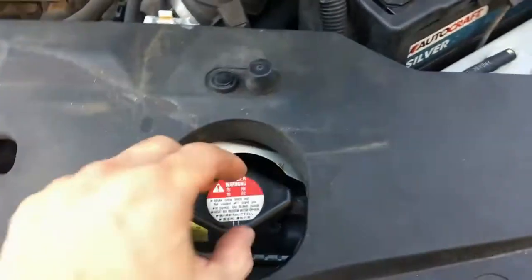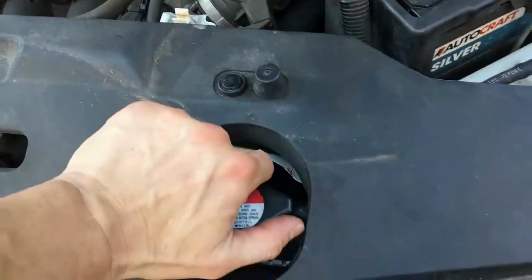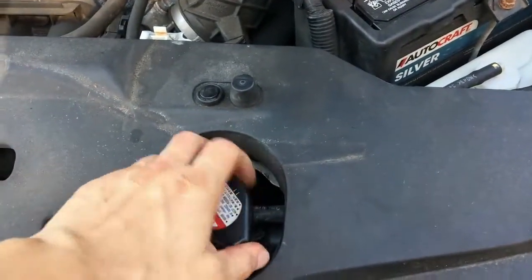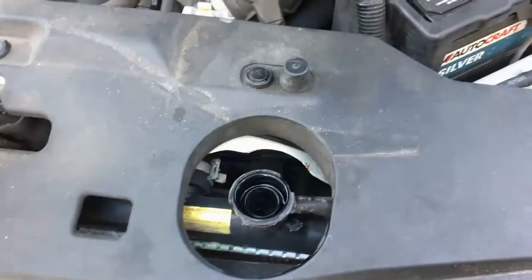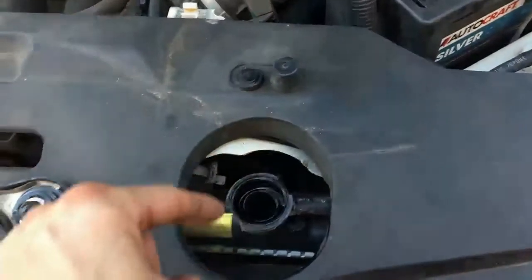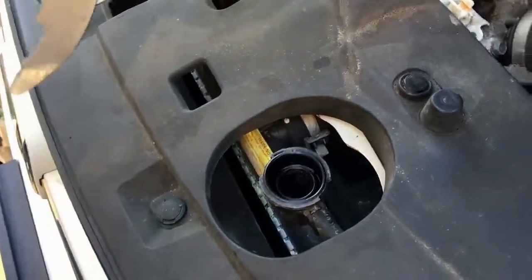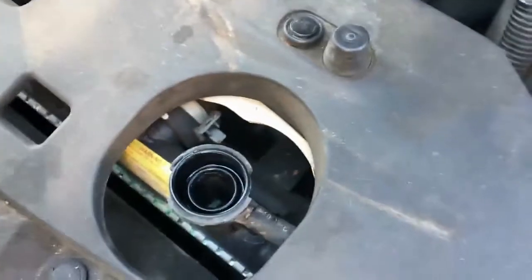So starting from the beginning, knowing where the grooves are, and they don't tell you, unfortunately, we're going to loosen, and then loosen to here, and this is the angle where you pop it off. So that'll help the draining, and the last step is we're going to fill it in here. Now we're going to start with the upper radiator hose, because we've let it drain a little bit and it's probably pretty clear, and if some of it leaks out, it's fine.